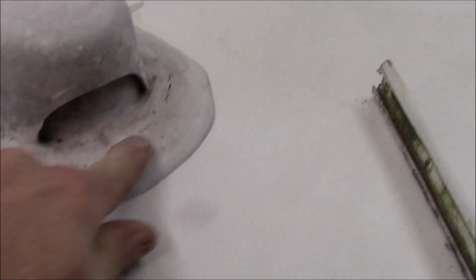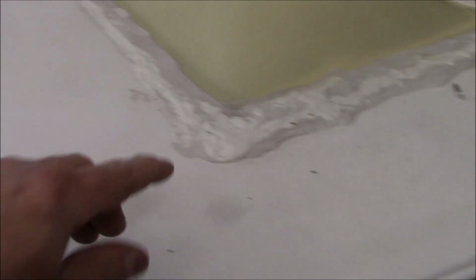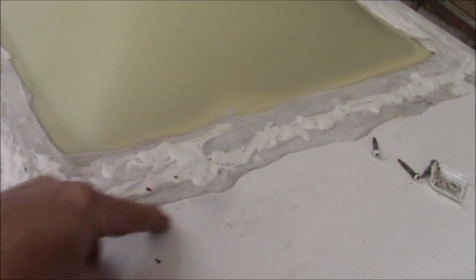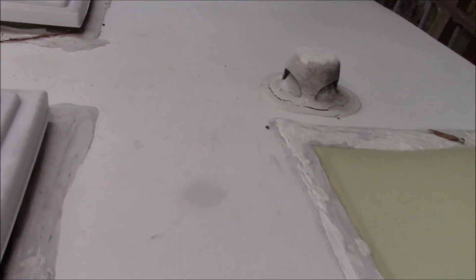So you see all this stuff cracks. This is their cash cow. This self-leveling is their cash cow. So they just want you to keep buying it and buying it. And you can see someone's already, see the color, the discoloration? Somebody's already tried to slather this stuff on. It just doesn't work. That's not the way a flat roof functions. So, you know, don't put that stuff on there. They exploit people's ignorance of roof systems. And you don't know any better.